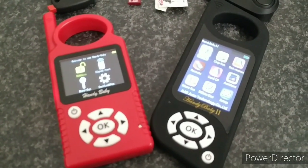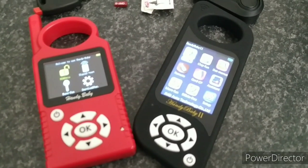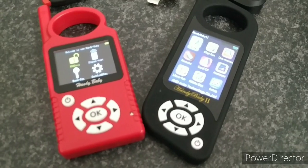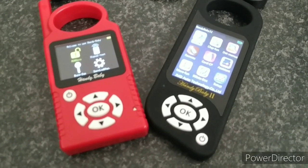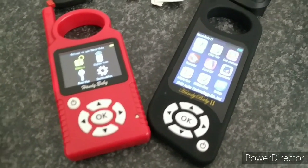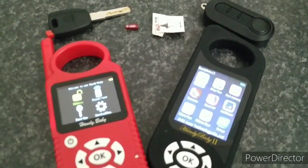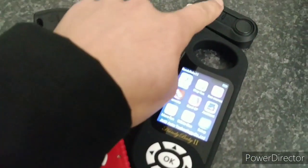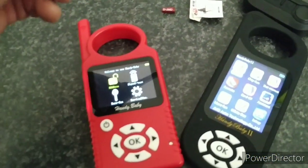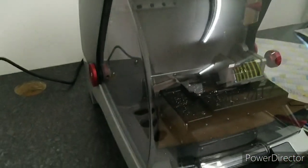As we've got outside, we've got that Ford Ka using the Fiat immobiliser system. This process will be the same if you have a Ford Ka, a Fiat 500, a Fiat Punto, Iveco Daily or Eurocargo, or anything using the ID46 transponder. The key is a pre-coded key — we cover that on our training courses. In this video I'm just going to show you how to clone the information from the customer's working key to this new key, which we've cut using the Silca Futura key cut machine.